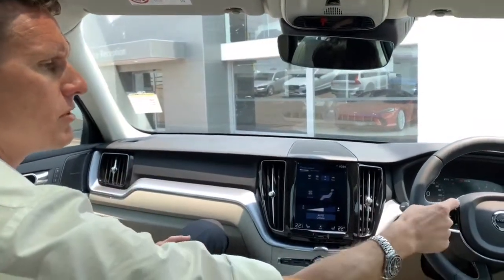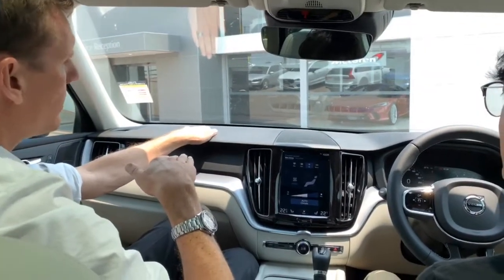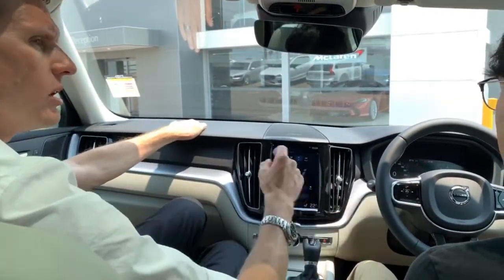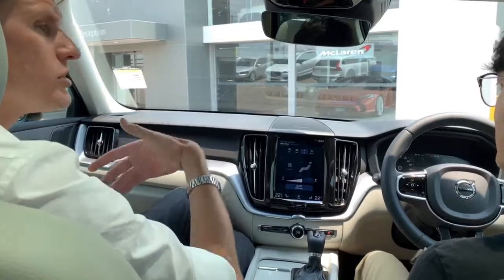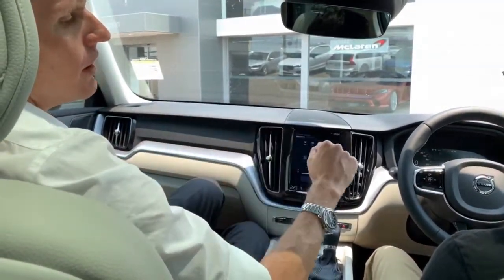And you can adjust the number of lines with this, and that's your proximity to a slower car. Okay. Now, one line is a 1.5 second time distance between you. And whenever you add an extra line, you add another half second of time. That's distance in between the cars. That's right. So we use time rather than a set distance because the speed changes. Sure.